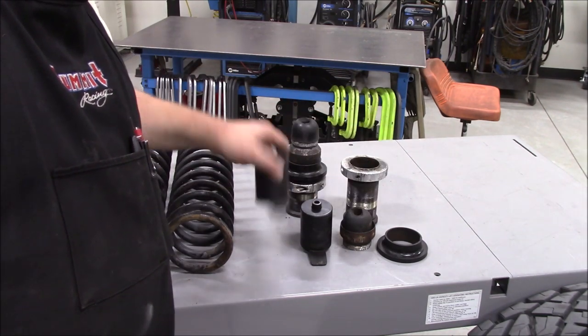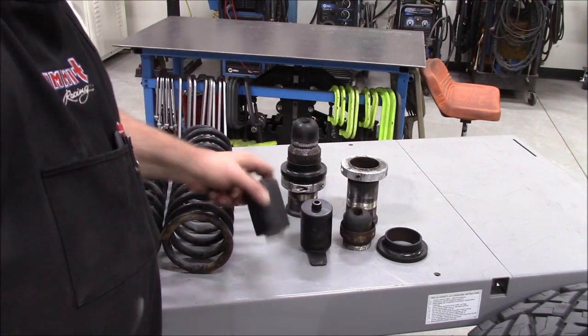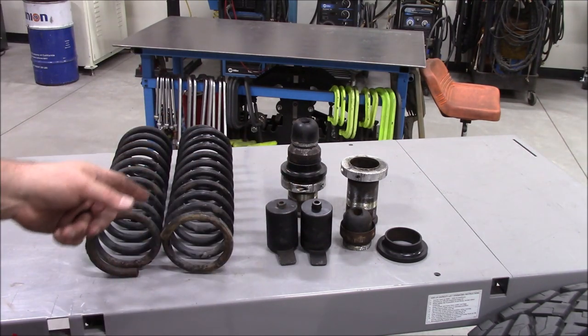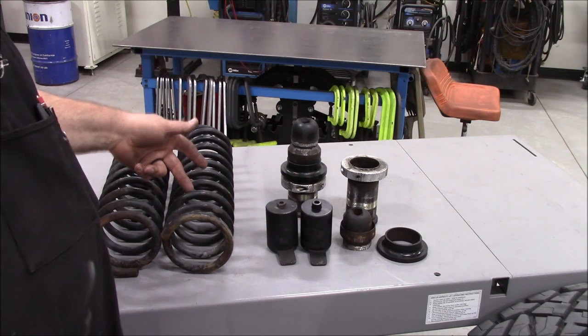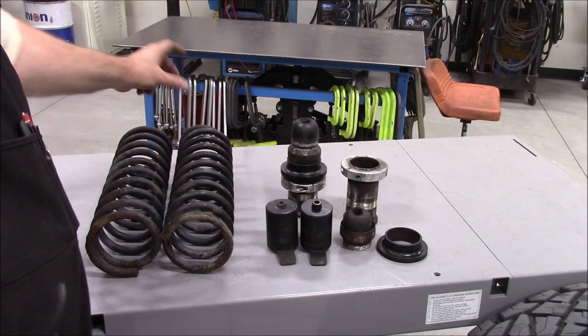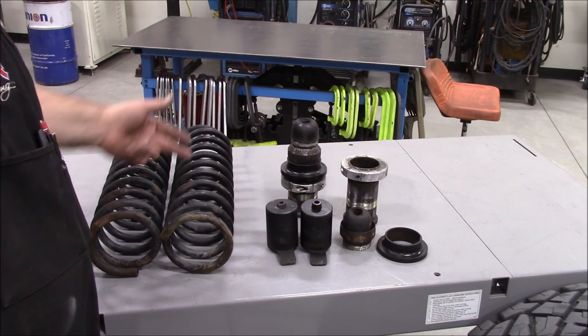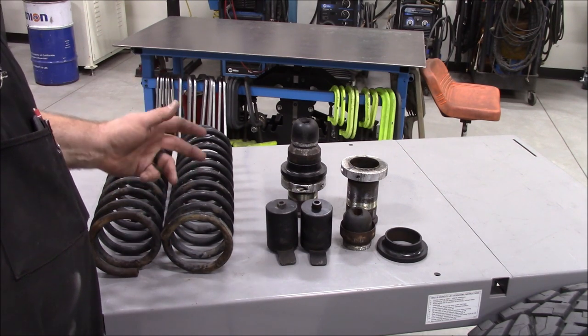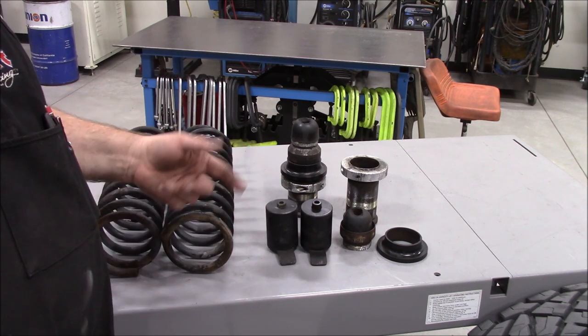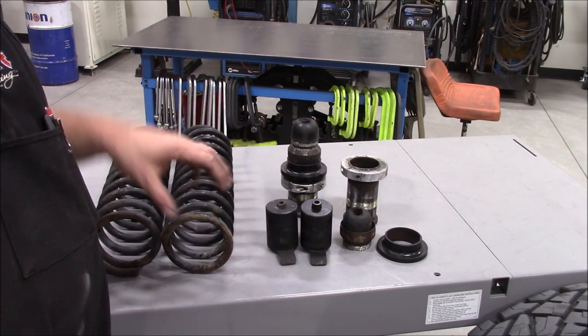And here's the bump stop side machine. So I don't think I'm gonna run the retainers that I fabricated, because the new Metalcloaks are a dual rate, so they have a built-in stackable coil set at the top that provides more pressure to keep them seated. So I'm not gonna run those. I'm just gonna run the actual Synergy stackable bump stop adapters.